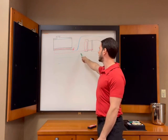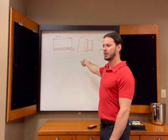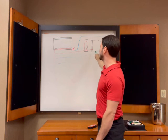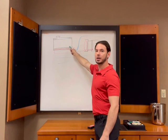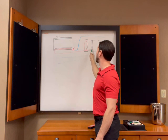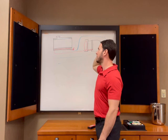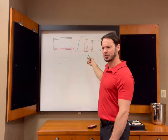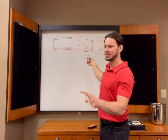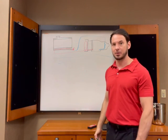Some of you may know that at, I think it's 50, you've got fourth gear prohibit, which is actually the reason why they did that. Remember, it's an old car. It's because they want the engine coolant hot. So they assume that if your ATF is 50 or below, you haven't heated up your coolant enough yet. And then is it 120 or 100 or 150? Obviously it's in Celsius, so it's in there somewhere. That's when it prevents lockup of the torque converter.